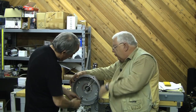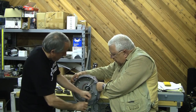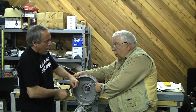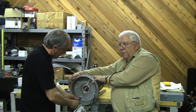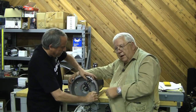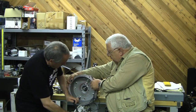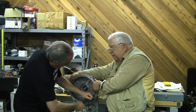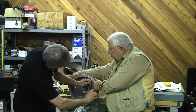This is a sort of a store-bought adapter — we don't have to measure a whole lot. We had to put in some different holes and grind off these ears a little bit to fit the mounting for the transmission that Beck did. This is an off-the-shelf VW transaxle adapter; we have a VW transaxle and a motor that matches it. But you have to trim and fit a little bit because it's not exactly a Volkswagen — it's a Beck Speedster. And this isn't exactly a Warp 9; it's a high-performance golf car motor. I like to have the connections sort of top dead center so my cables don't get in the way of my battery boxes.